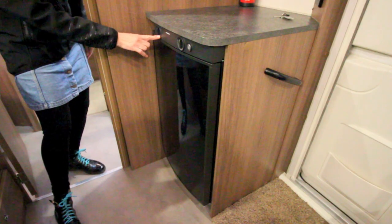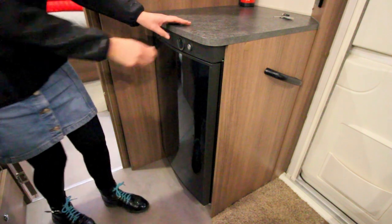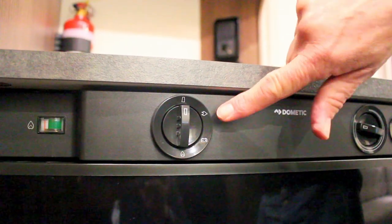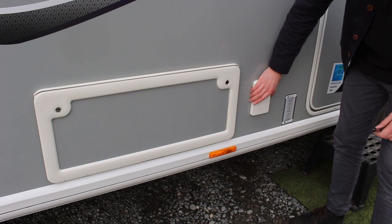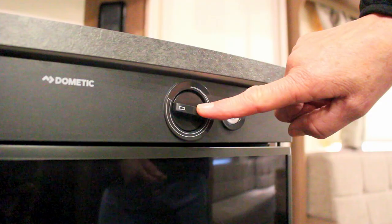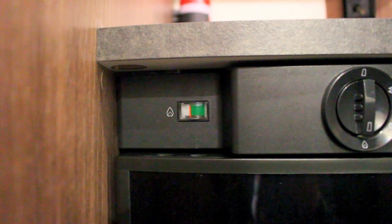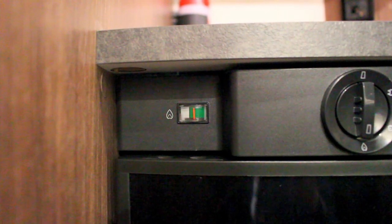Your caravan's fridge can operate off a 240 volt supply from your campsite or off the caravan's gas system. Unlike their UK counterparts, this fridge is unable to run off the car's battery as our trailer plugs do not allow for this. The fridge's leftmost dial allows you to select how you want to power it: the 240 volt plug, not the battery, or the gas connection. To use the fridge while plugged in, make sure the caravan's power supply is switched on, the 12 volt system switched on and the correct temperature selected. To run the fridge on gas, hold in the temperature dial and the fridge's igniter at the same time. When the fridge ignites, the orange indicator will move into the green. This can sometimes take 20 to 30 seconds if there is no gas already in the lines, so be patient and continue to hold these two buttons.